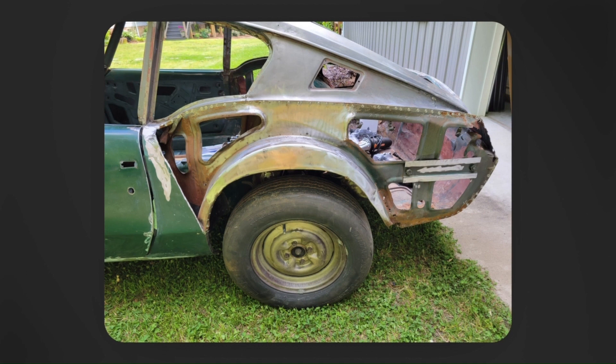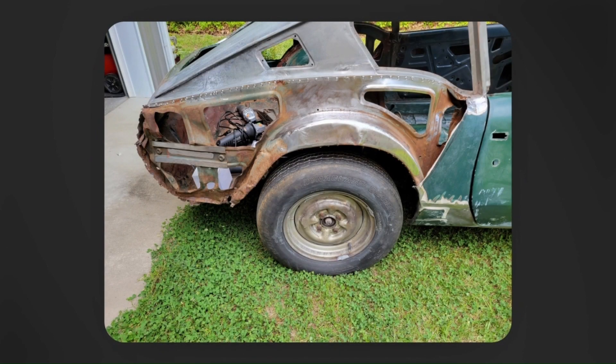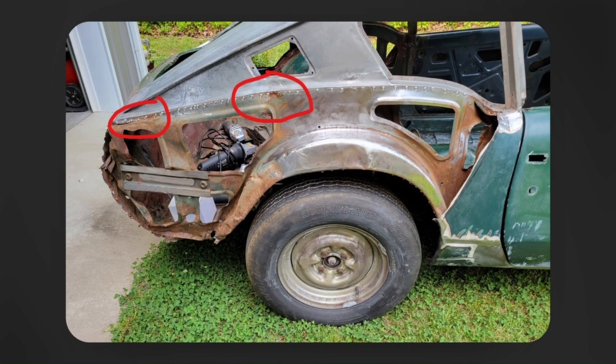Here's the left-hand side. You can see some of the distortion in there, but the back side isn't terrible. You can see where some water got in and it rusted along the bottom edge behind the wheel arch. Here's the right-hand side, which was far and away the worst of the two sides. You can see some of the distortions in the top line of the rear wing — such as the dip at the very rear and the peak roughly halfway up. This provides a good sense about how the back of the car was pushed down and in during its most severe accident.